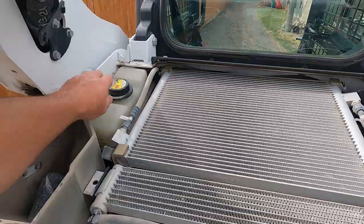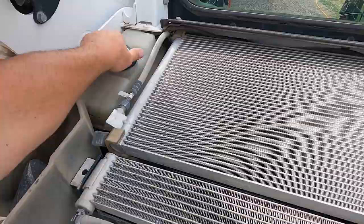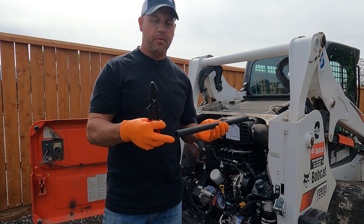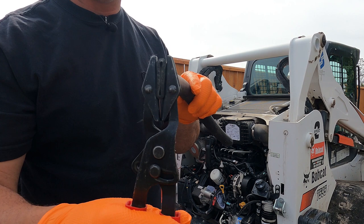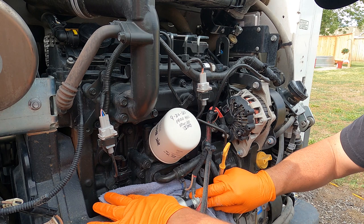I've already removed the top plate, but first you want to release the pressure by removing the radiator cap — because when we pull this hose off the oil cooler, if you have pressure in there it's just going to squirt out and make an even bigger mess. Two things you'll need: about 18 inches of 5/8" heater hose — your manual will say 3/4" hose but 5/8" works better for me — and a pair of hose pinch pliers. These are to pinch off coolant hoses, fuel hoses, whatever. They squeeze the hose completely closed so no coolant comes out when we unhook it from the oil cooler.